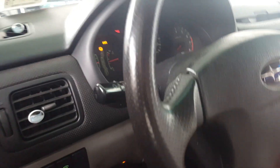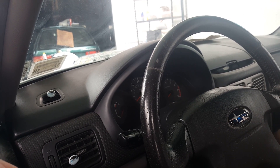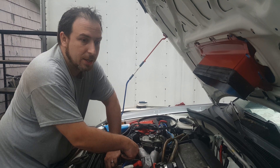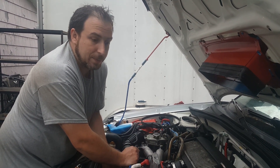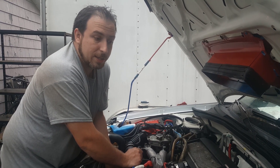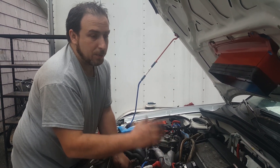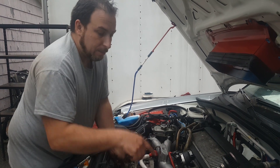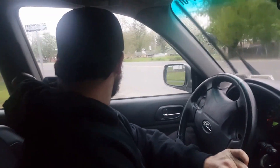It just shut off on its own. When the tuner was here, the car just died. We didn't know what happened — we logged some stuff and we weren't getting a crank position sensor signal at all, which is strange because a car shouldn't run without it. We took the sensor off and lo and behold, after screwing around trying to get it off for a few minutes, it was actually a bent pin. We plugged it in correctly and she started right back up again. The number one thing that prevents an engine from starting is wiring — stupid connectors, clips, and grounds. When you put a new engine in, that's always what it is. Both of our grounds were loose and our crank position sensor connector was screwed up. Other than that, it was great.